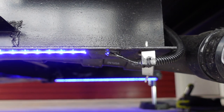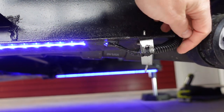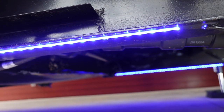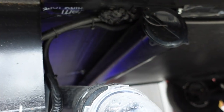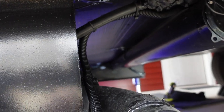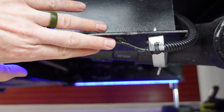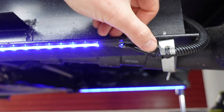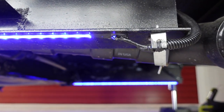It's the same story on the driver's side. On the outside of the I-beam you can see the sewer connection, and this black loom is where the other side of the blue downlighting is fed. The loom goes up and runs to the sewer storage add-on, which I used as a path to route the wires. I used liquid electrical tape and shrink tubing to protect these wires and beef them up, and of course zip ties and tie wraps all over to keep everything secure.